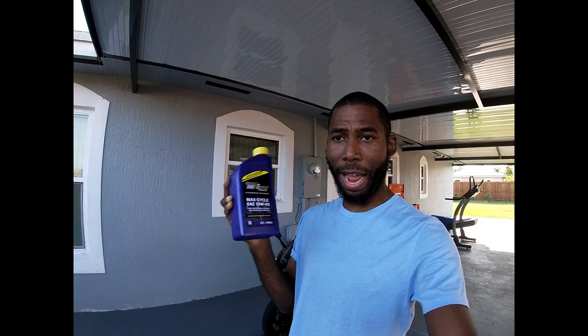I got some Royal Purple 10W-40 high-performance motor oil for motorcycles and ATVs. You only need two quarts for this bike. I also got a K&N oil filter. I know a lot of people online say bad things about K&N, especially on the forums for the 2018 and Ninja 300, but what's cool about these K&N filters is you can change out the cartridge on the inside and reuse the canister over and over — pretty dope. So that's what I'm installing today.